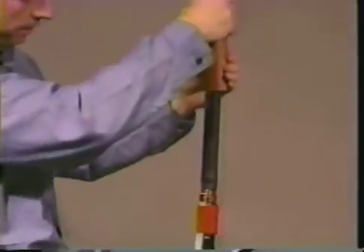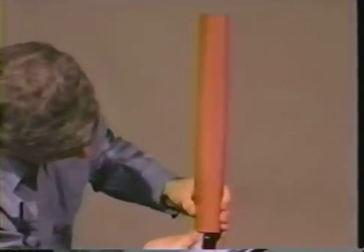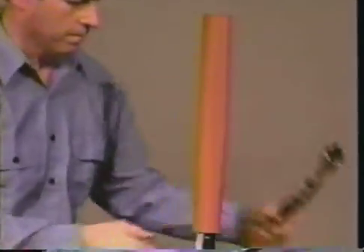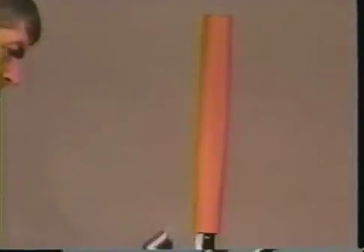Now position the red HV tube at the bottom edge of the red sealant on the jacket. If working on a unishield or wire shield cable, twist the drain wires to make a ground lead at this time.